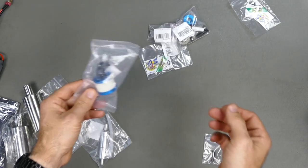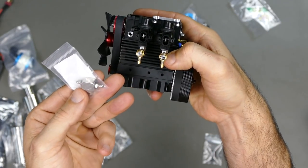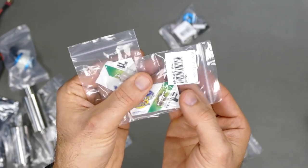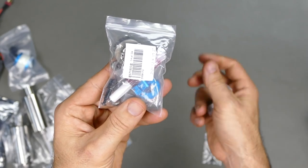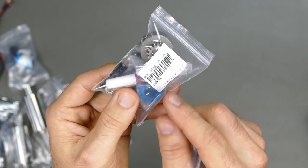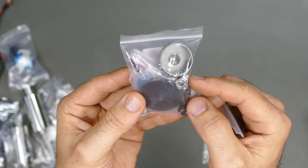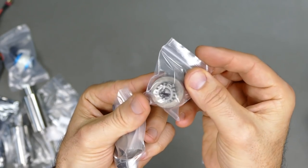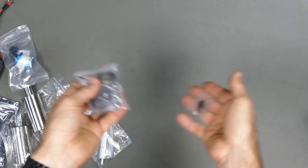There's a T-way fitting for the fuel since it's a dual carburetor — fuel needs to go either way to the tank. You need two glow plugs — type F, which are for four-stroke motors. Very importantly, you need a clutch — about 16 tooth, generic style aluminium clutch with shoes, thread lock, a flywheel (which you won't use), a clutch nut, screws, and four bearings. You can also get different sized clutch bells separately.